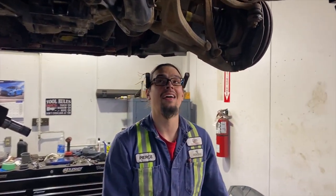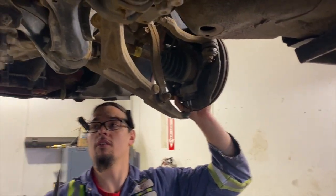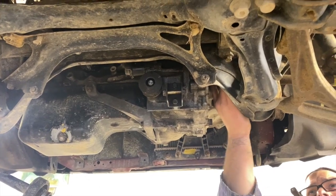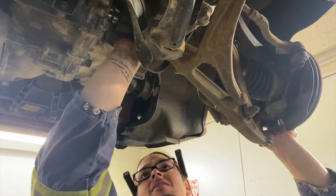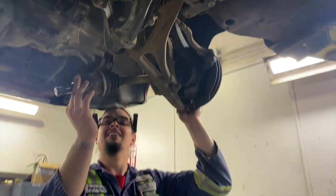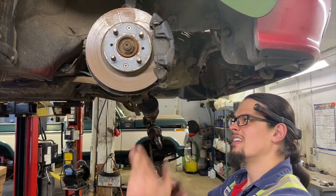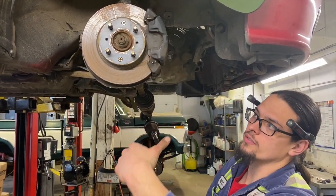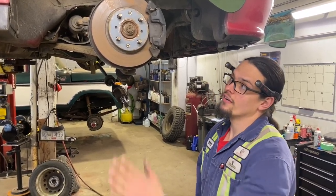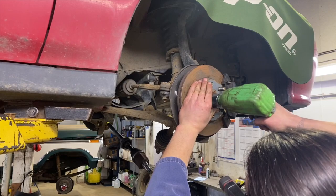And now, this side, I believe we've had to do it just to get the tranny out. Let's try it. Jar. Like so. Just like that. Now you can just undo your axle nut, and sometimes these will be stuck in there, so you might need a special puller that bolts up to here. But you're not using the CV shafts anyways, so you can wail on her with a hammer and not have to worry about crushing those threads. 32 mil axle nut. Oh, baby.